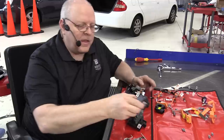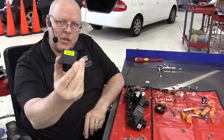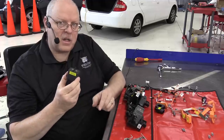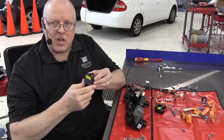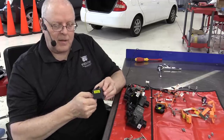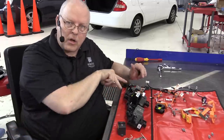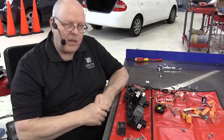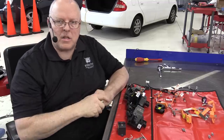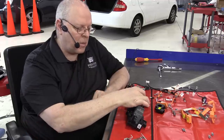All right, now, this electric vehicle, like many electric vehicles, will have a fourth contactor, and this one is called the charging system contactor. So basically what this does is, when you plug in your vehicle using a level 1 charger or a level 2 charger, the J1772 compliant charge connector, this contactor will close instead of the positive contactor, and it will allow an alternate current path for DC current to come in and charge the battery at a lower current rate than through the big two wires that connect to the front of the battery. If you have the fast charger option on your Bolt EV and you plug in the fast charger, then this contactor is still here, but it's not used.